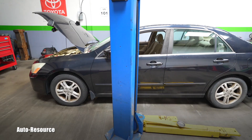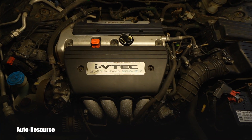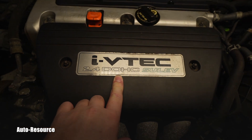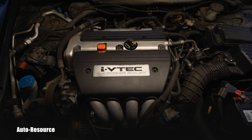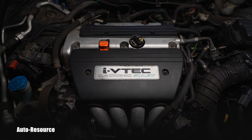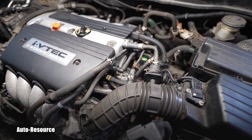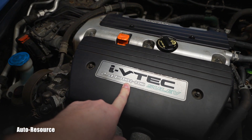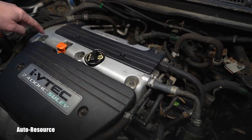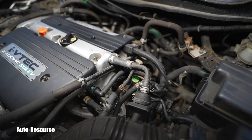This gives me a chance to show newbies what's under the hood. This is Honda's famous 2.4-liter four-cylinder double overhead cam engine — DOHC means double overhead cam. It's famous for good reliability but also has one well-known issue: timing chain stretch. The camshafts are located underneath this valve cover — here is the intake cam and here is the exhaust cam. Because there are two of them, you need two sensors.